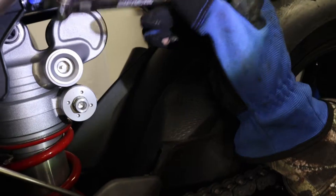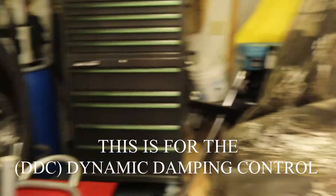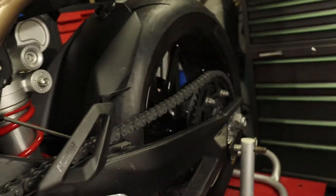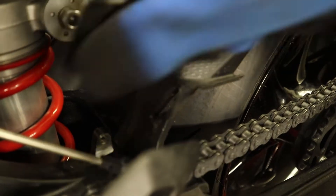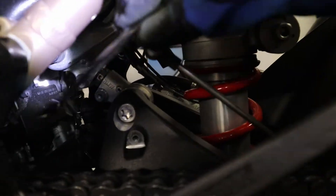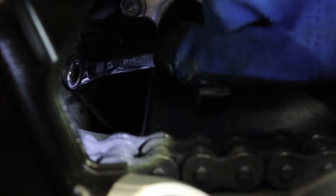I made a mark right here — if you get down a little bit you can see this blue mark, just in case you have to recalibrate or something like that, so I know where it was at. I used this piece of cardboard and got that mark in there. Then I used a 10 millimeter wrench — I already loosened it up so it's just hanging on by a couple threads. Once that's removed we just throw a little zip tie on it to hold it back. Also remove this black wire from the clip that's on there.